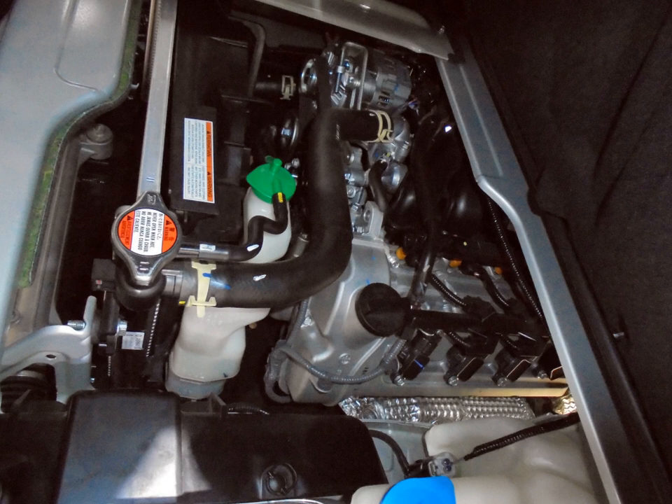Inline-fours — F engine: Suzuki F engine, 0.7 to 1.1 L. F6B — 0.7 L, 658 cc, DOHC 16-valve, 65 mm × 49.6 mm. This shares the bore spacing of the three-cylinder F6A, although the stroke was shortened considerably to keep the displacement nearly the same. January 1990 to May 1997.